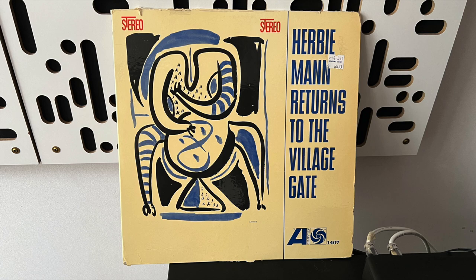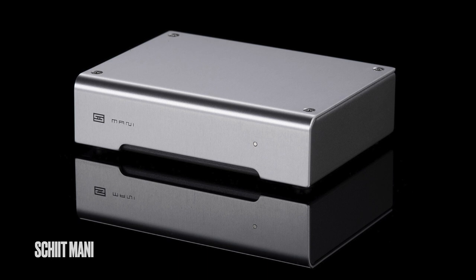I was in it, feeling it, digging the Theory turntable. I took time to compare the built-in Pluto 2 phono preamp — which you can bypass — against the Schiit Mani. I felt the two were comparable. The Mani was a little more laid back and sweeter, but not as exciting, vivid, or transparent. Part of that may be because there's no cable between the tonearm and the Pluto 2. For moving magnet cartridges, unless you're going to spend $500-plus on a phono preamp, the Pluto 2 is definitely a solid place to begin your analog journey.